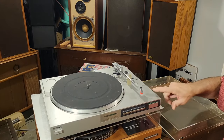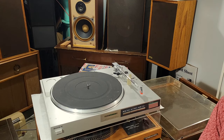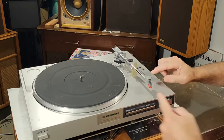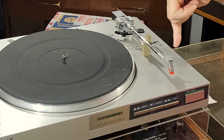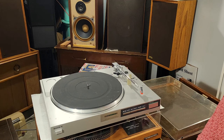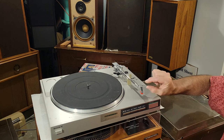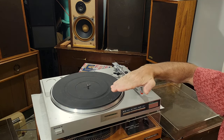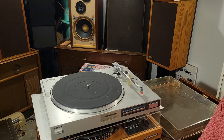This does appear to be a P-mount. I do see a symbol here — T4P — that indicates this is indeed a P-mount. If you're unfamiliar with P-mount, it's simply where the cartridge plugs directly into the head shell, instead of being mounted on a head shell that comes in over the top. I have a P-mount cartridge on my PL630, but it's mounted to a standard head shell with an adapter. The problem with using a P-mount on an adapter is that if you don't have VTA, and you're adding thickness with an adapter, then your tone arm may ride up too high. My PL630 does have VTA, so I've got it jacked up relatively high because of my P-mount and adapter cartridge.